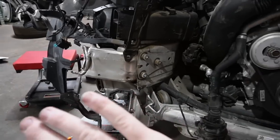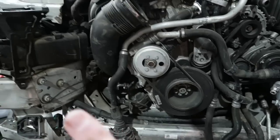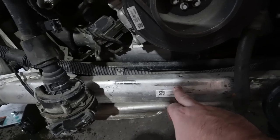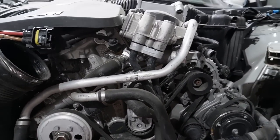Looking pretty good — it's not buckled inwards. It looks like the impact was from the side, shifted everything this way, it wasn't directly on. That also could have saved the engine because there's no subframe damage here. There's just subframe damage there and there, but nothing right over here, which means the steering rack is good and the pulleys and everything were undamaged — which is honestly such a good sign.